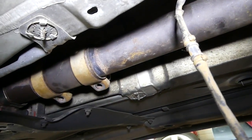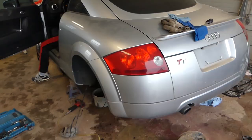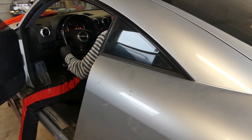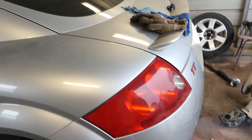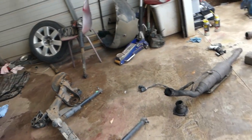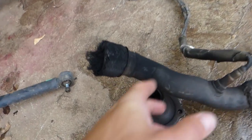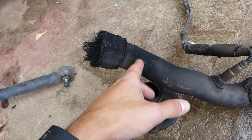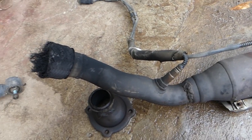Alright, we are ready to start it now. Let's see what it sounds like and if we have an exhaust leak. It sounds pretty good - wow, completely different story! So that's how we removed and replaced the flex pipe. If you don't have a whole catalytic converter assembly, all you have to do is buy a new flex pipe, cut it right here, and weld it. Pretty simple. Thank you guys for watching, please subscribe and see you next time.